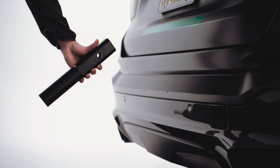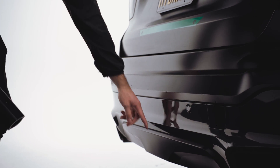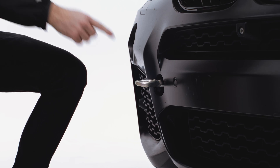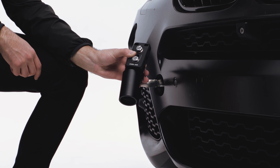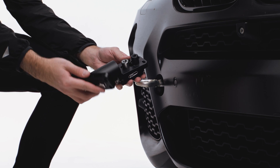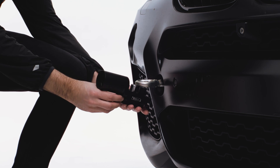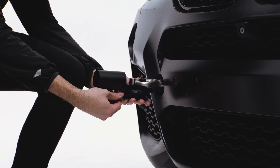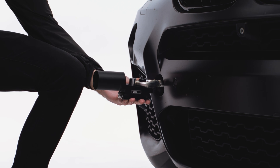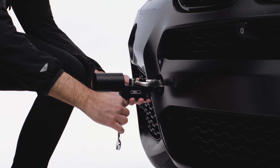To mount the slider vertically to the back of a vehicle with a tow hitch, you will need to install the tow hitch adapter. First, we will need to install a tow hook, which you can find on most SUVs, and then we can install our tow hook adapter. Make sure the tow hook is firmly attached to the vehicle and that the ring is horizontal to the ground. Place the ring of the tow hook inside the tow hook adapter and fasten the bolts tightly. If more clearance is needed between the screws, adjust the bottom bolt.